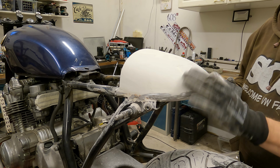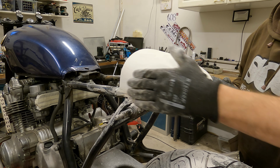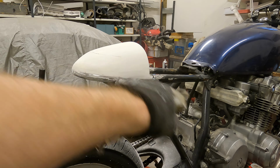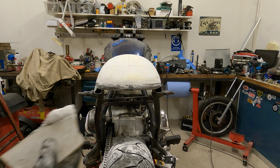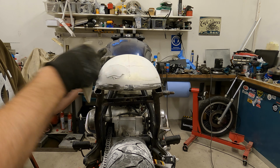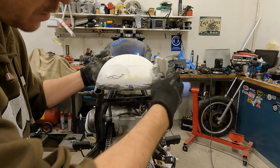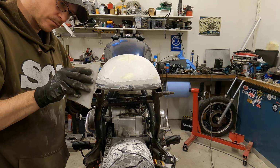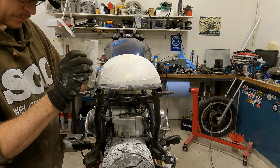After the filler had dried, it was sanded smooth using different grit sandpapers. I used different kinds of sanding blocks too, like a piece of wood, to get it right. In terms of time, this took almost a week. This was because the drying time of the filler, in my slightly cool garage, was longer than usual. For this reason I waited overnight after each layer before sanding it smooth.